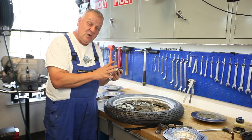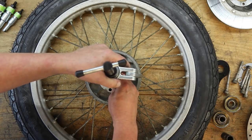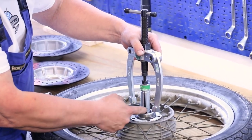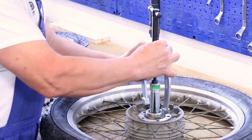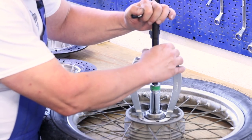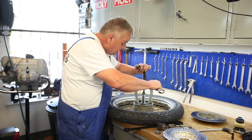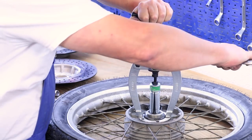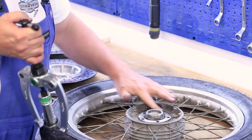The bridge — also called the counterstay — is the key part. I'm going to drop that right in here, tighten this nut up a little bit, and what that does is bring a wedge up between the two puller halves and expand it. Then just adjust this down, get everything centered up, and adjust this nut down. I can feel it's under tension. Now using a 32-millimeter wrench, just tighten this nut while holding the shaft steady and it'll pull the bearing right out. Super clean extraction — no pounding, no distress to any part of the wheel.